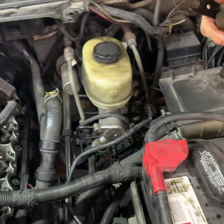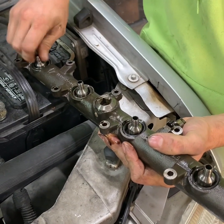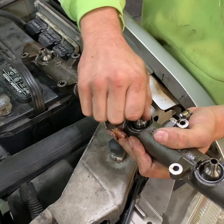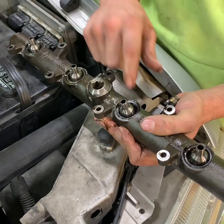I never really did buy a special tool for these. The other rail I've already done — I replaced the O-rings in it, but these have quite a bit of movement. The other one was worse and you could actually spin one of the cups, so that's going to be a prone leak after we get all the new injectors in. So to do it right, we're going to replace the O-rings in these.